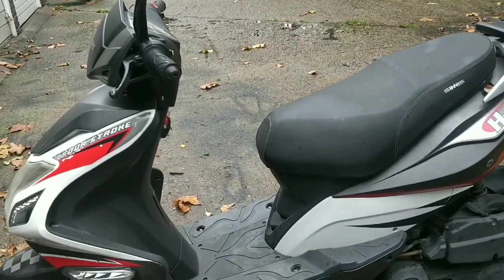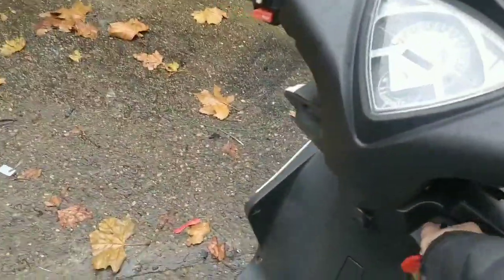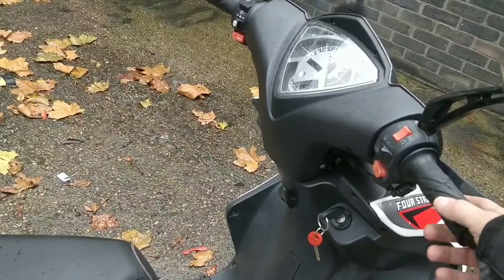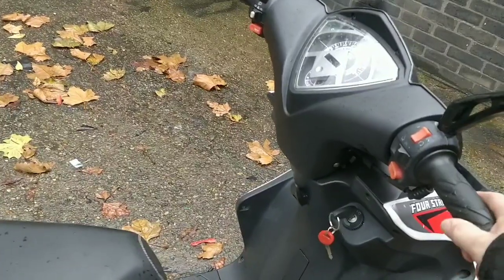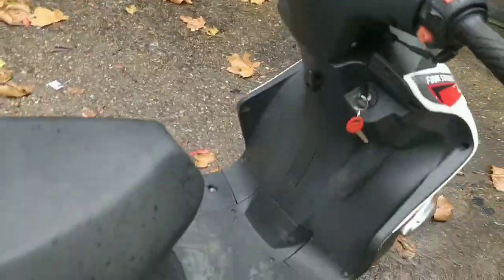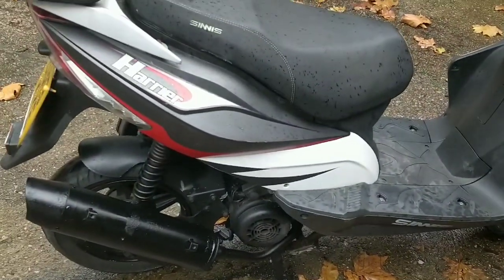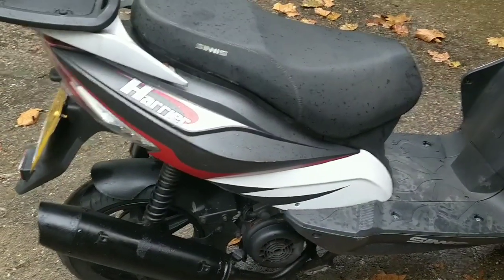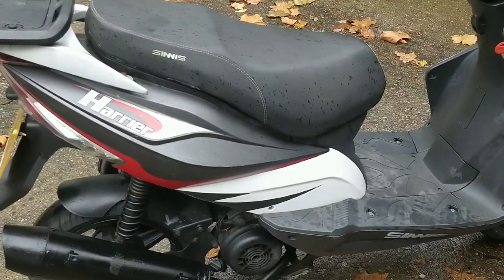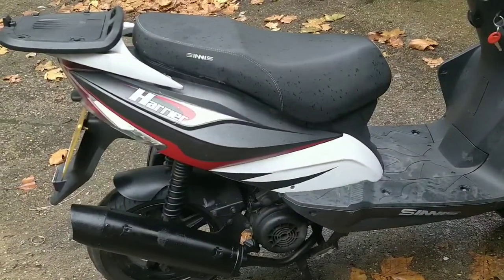It looks like I spoke too soon. We start it up and it idles fine, give it some revs... it's choking itself. There's something going on - it will either be fuel starvation or air starvation. Let me pop the bucket seat out and have a quick look. If I can do this in half an hour I can still get to an MOT. This is exactly why you do pre-MOT checks. It's obviously not a carb problem regarding the insides because that's a brand new carb - the only thing I could suggest is that the jetting isn't right.